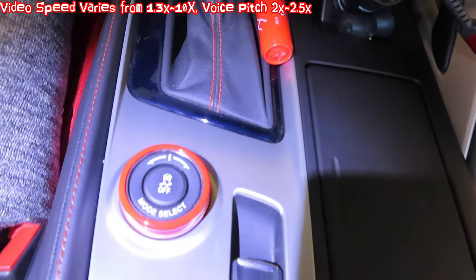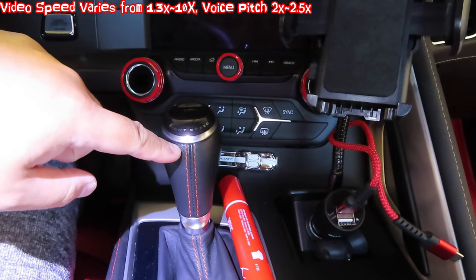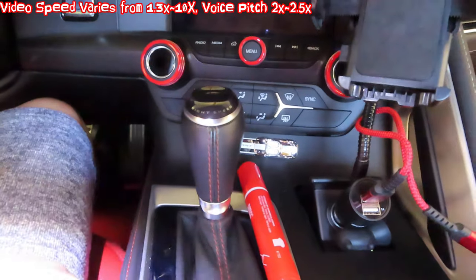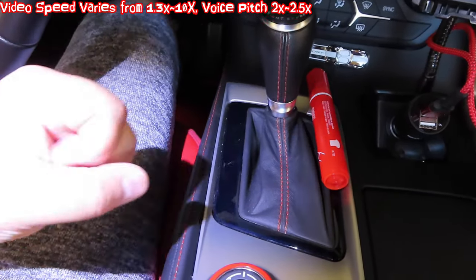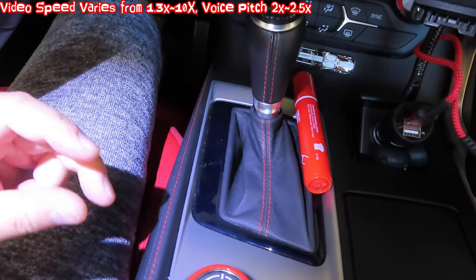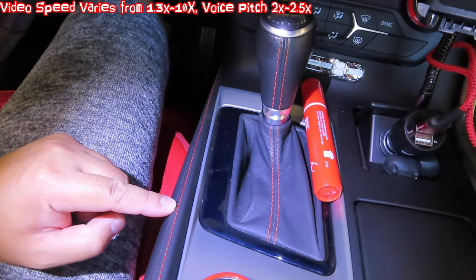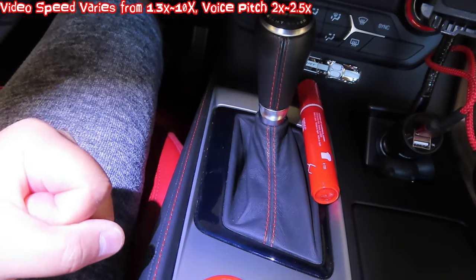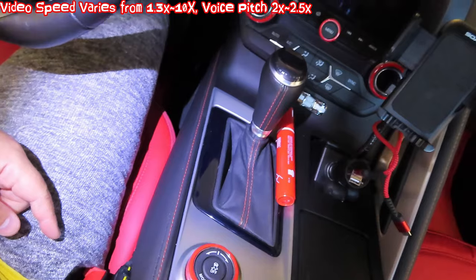Here's a little bit of the result — it looks fantastic. Some people were suggesting to saturate the stitching first using alcohol or water to make it easier to apply. I don't think that's a good idea because I really want the fabric to soak in as much ink as possible. If you saturate with another liquid first, it just dilutes it — as that liquid vaporizes, you don't have as much ink inside. So do it dry. When it's dry, it soaks like tissue paper — actually fairly easy to apply.